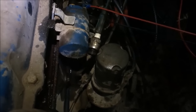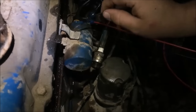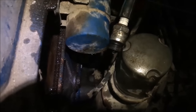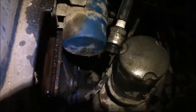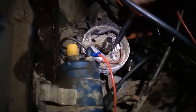What we're doing is bypassing the point system, basically taking this ground wire, hooking it up to the coil, grounding it out, and interrupting it. You can see that as we interrupt it, it keeps sparking through the spark plug. That means the coil is good on this truck and we should be able to hook it up and run. We've eliminated the coil as a problem.